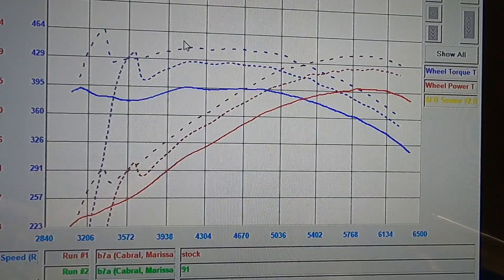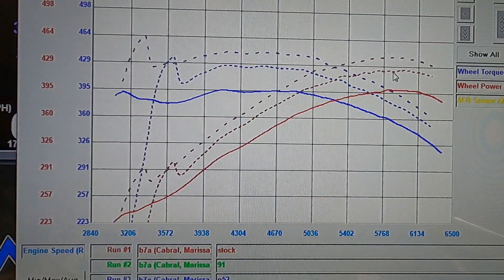These are very basic bolt-ons — nothing crazy, nothing too expensive. E85 is a great addition to any car whether you're naturally aspirated or boosted. The gains are there; obviously the gains aren't going to be as big as if you were boosted, but you're still getting gains and the car is also running a lot safer being that it's approximately 110 octane. You get more power from it, and since it has more volume it helps cool down the air charge since alcohol runs colder, so the cylinders and engine are going to stay a lot cooler. As long as you have a flex fuel tune and a sensor, or a dedicated E85 tune, I highly recommend it. Thank you guys for stopping by — leave a comment, like, subscribe. We have a few more projects coming up, so stay tuned.